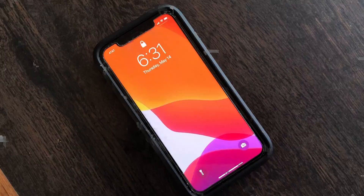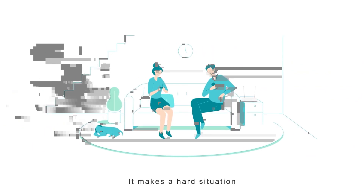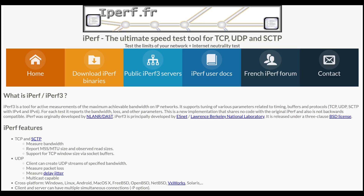We're also using an iPhone 11 which also supports the Wi-Fi 6 standard. The total square footage of the house is 5,000 square feet. I will be testing Wi-Fi connection in different corners and floors of the house. In this test we will use Fast.com, powered by Netflix, to perform internet speed tests, and also iPerf 3 for performance testing. iPerf 3 is a tool to measure maximum bandwidth on wireless or wired networks. We will be using only the 5 GHz channel for best performance, and our MacBook Pro is connected to the router via ethernet and configured as the iPerf 3 server.